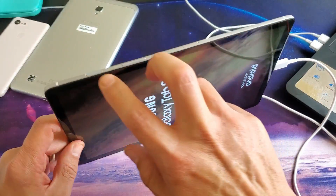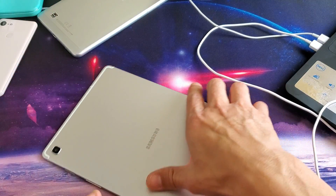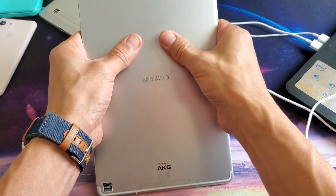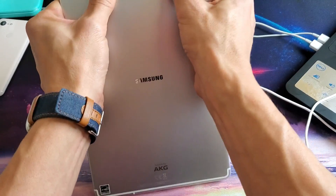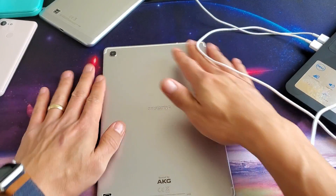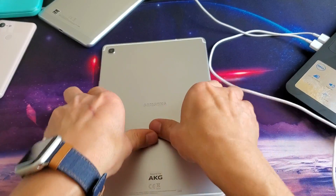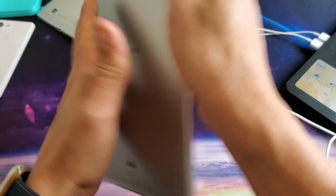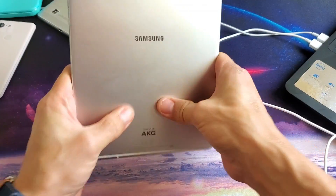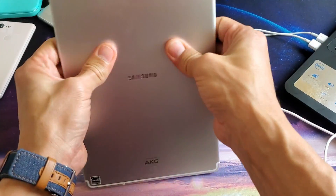If it's still down, you may have to try the force restart method five or six times. Another possibility is that your screen ribbon in the back is actually loose. Rather than taking everything apart, we can try this: go ahead and grab your tab and press firmly all over the back like this. Use your thumbs. If you have something soft on the bottom — like a big mouse pad — you can do this. Press in all over the back for like one or two minutes, keep pushing in, then press the power button and hopefully you see your screen light up. If not, turn it back over and keep doing the same thing, especially in this area here. Just go along everything, keep pressing in there.